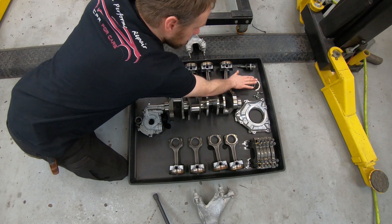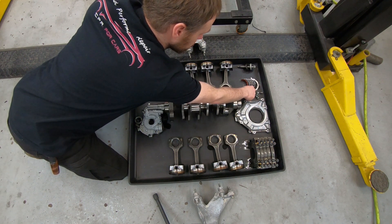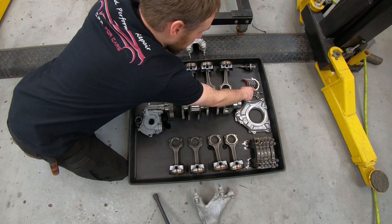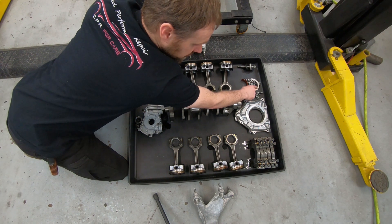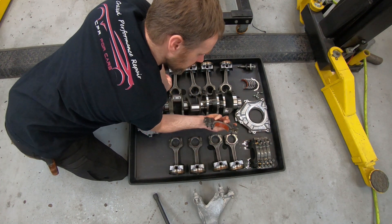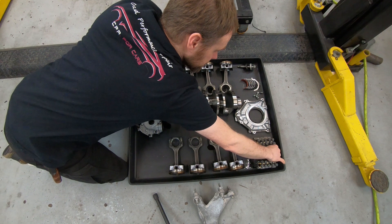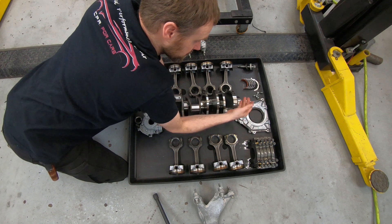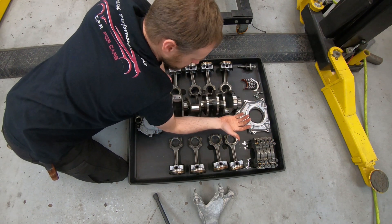This is the part that was on the block, that's why there's only a few bearings here. The other bearings are all still in here, and there's only one thrust plate. Now one thing of note: these Ford engines — this is identical to the EcoBoost I had apart — where it had these little half thrust plate pieces. The block only has one half of it where it's got a thrust plate. So the main bearing section actually has one on each side here, so there are two on that section. That's obviously the part that controls the end play, and this part is towards the back of the motor, towards the seal side. That's because if it's like a manual car, it will be pushing against this one, and the other direction never really sees any stress.